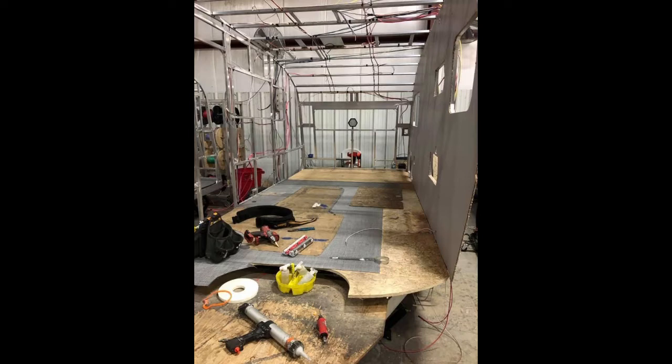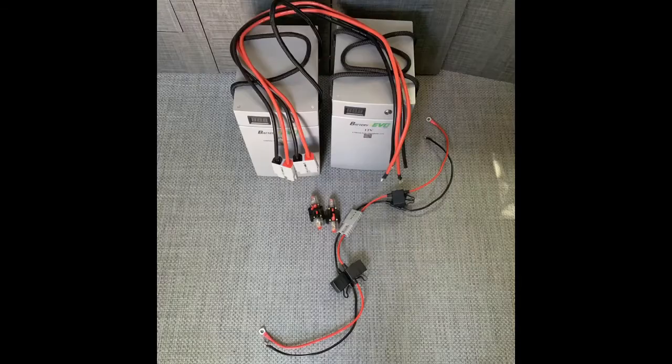The In-Tech is a little different in that when I had to choose my wiring path, you just can't drill through a wall and you're not able to install grommets inside it. So for In-Tech owners, I picked my wiring path as the shortest distance based on the easiest path to our battery compartment, which is all the way across the trailer from the converter.